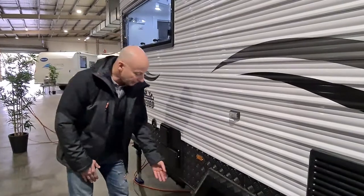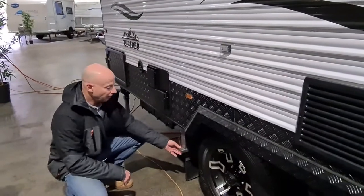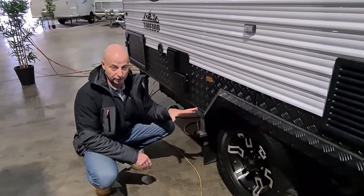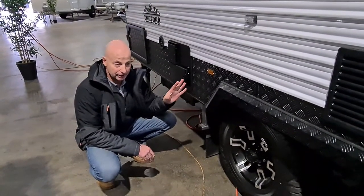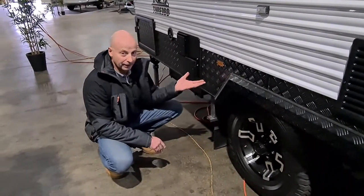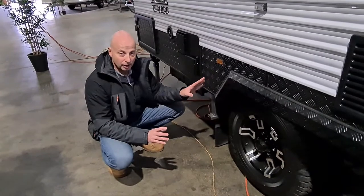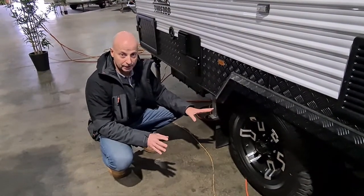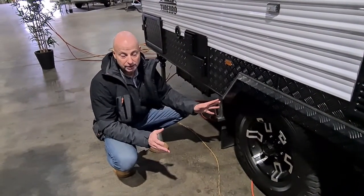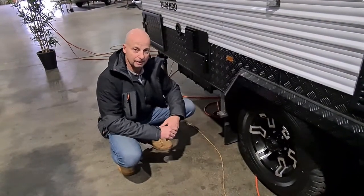Next up, let's have a look at the jacking point. This thing behind the wheels is actually the caravan jacking point. The caravan's supplied with a hydraulic jack which clips in here and you lift the whole side of the caravan up and change whichever wheel you need to change. The correct way to do that: before you start jacking the caravan up, loosen the wheel nuts on the wheel you need to change, lift the caravan up, wheel off, put the spare wheel on, tighten the wheel nuts up but not fully, then lower the caravan down and then tighten them up 100%, really tight. After you've done 50 or so kilometres after changing the wheel, just check the wheel nuts are still tight — only takes a couple of minutes.